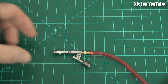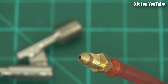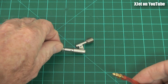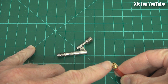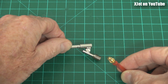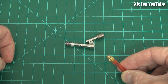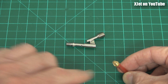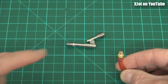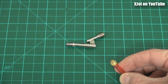Here is the fuel metering assembly. There are two parts to this. If we remove this brass piece, you'll see it has a very small hole in it. We've got holes in the actual atomizer itself, one on each side, and a very small hole in this brass piece - this is actually the fuel metering hole. The real problem is in here. There's just not enough fuel getting through this particular setup, so this hole is too small. The first thing I'm going to do is measure the size of that hole.